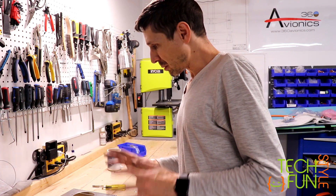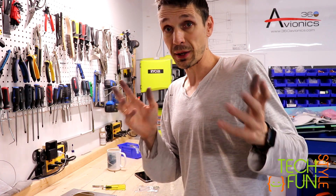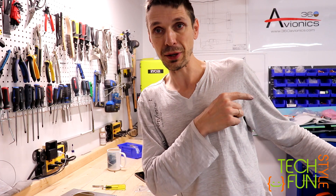I'm getting ready my landing lights. They're from Duckworks Aviation. So far no issues, no problems — just working, getting them ready, and hopefully after installing them to the leading edges, I'll be able to fire them up, confirm the light works, and then rivet my leading edges to my wings.